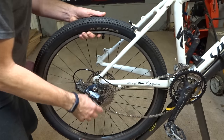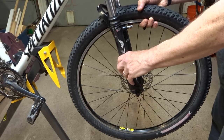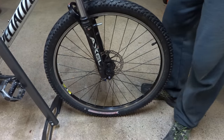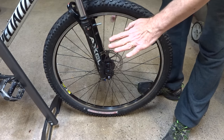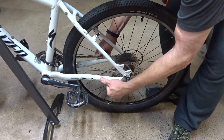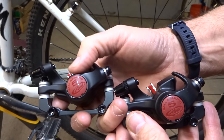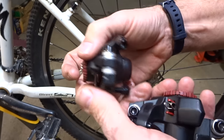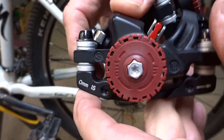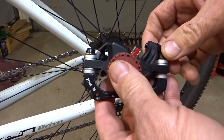Now I want to reinstall the wheels and make sure they're fully seated. To guarantee the wheels are fully seated in the dropouts, with the bike off the rack sitting on the ground, I'll release the skewers and then clamp them back in again. These are the calipers I'm going to be using — they're Avid BB5s. They're a mechanical caliper, meaning they use cables as opposed to hydraulics, and they already come with adapters made for the 160 millimeter rotors: a 20 millimeter adapter for the rear and a zero millimeter adapter for the front. They're nothing real fancy but they're solid little calipers.